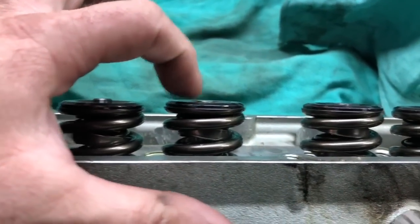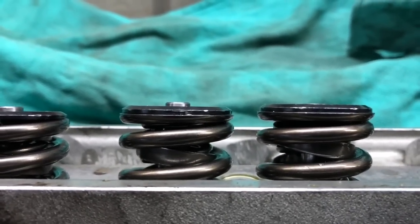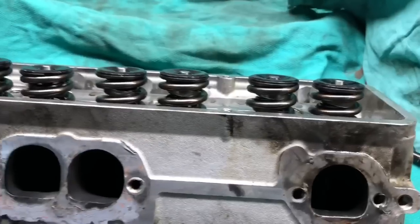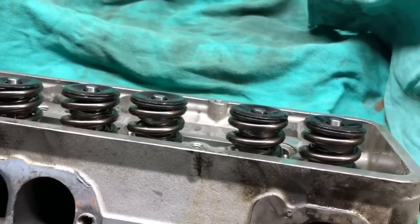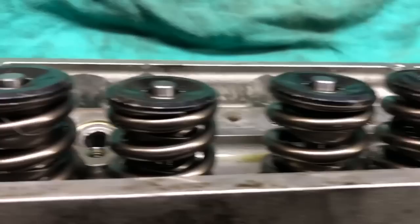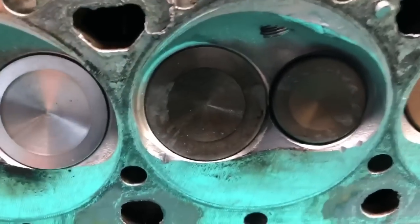I could get a 50-thousandths reduced lock and push that down, but I didn't do that. The valve heights themselves are the same — it's an optical illusion. The retainer is actually pushed up some. You can see the exhaust has more exposed, but the installed height on these is two inches — either two inches or 2.050, I think it's two inches. So they're all at two inches. The intake ones that are pushed up a little bit taller have more shims under the bottom. This one right here is a problem — let's see if we can figure out what's going on with it.